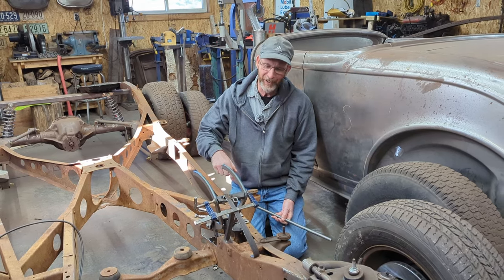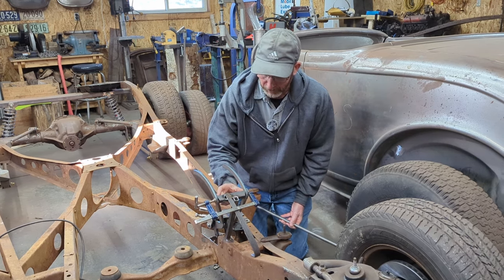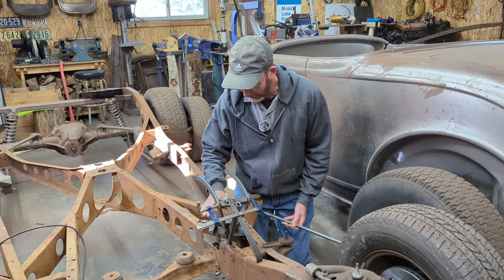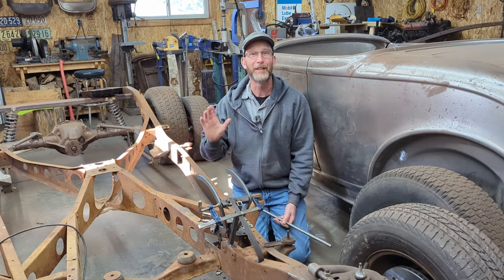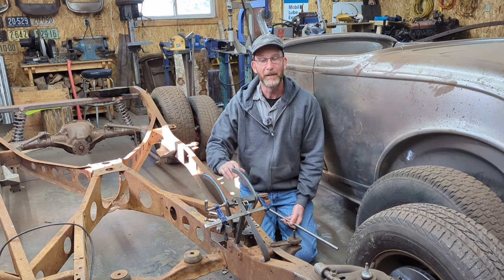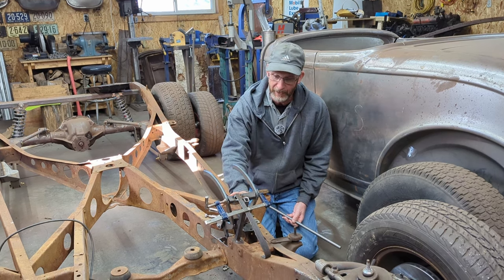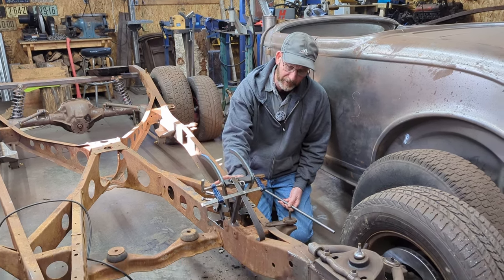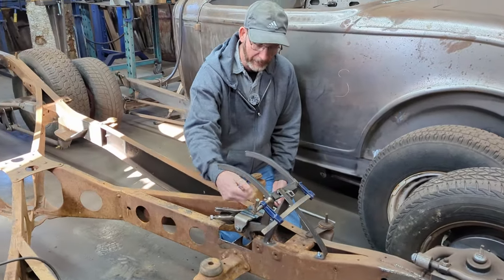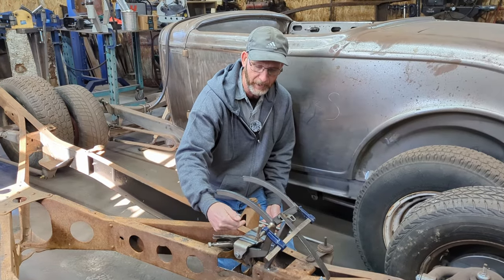So here we are so far. I have both of the pedals mocked in relative to the bracket that I put on the frame here. Kind of happy where it's at right now. It still looks funny to me because I am so used to having the pivot point below the frame. But as I described at the beginning of the video with the Plymouth, there's an area right here underneath the firewall where it's all open. The original one actually had a pivot point that sat about 3/4 of an inch behind this,